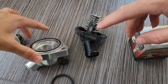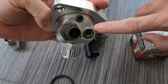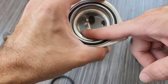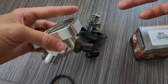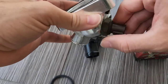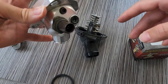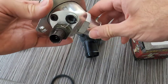From experience, I know that these little MPT fittings start leaking. As you can see, I have a lot of Teflon in there. And then also, if I put in one of the temp sensors and screwed it too tight inside, it almost pencil-sharpened itself — like the same thing when you sharpen a pencil. It was just horrible. But I'm trying to see if I can give it a second attempt at being reliable since I'm switching to the CSFM. And it's really tight up there to put a hose, so I'm definitely going to have to run a fitting on that section.